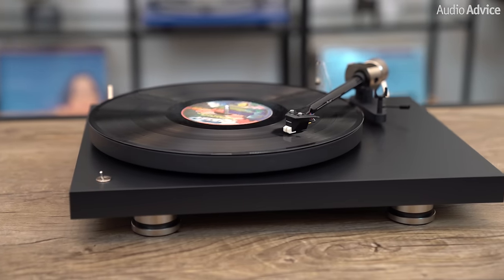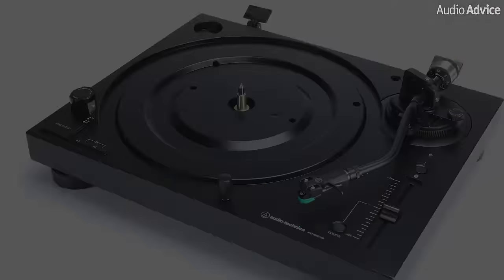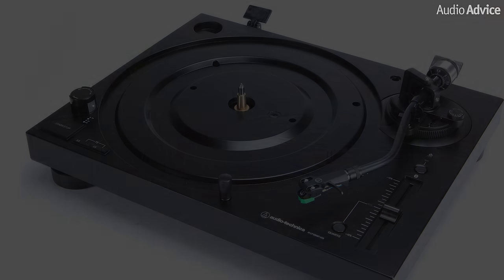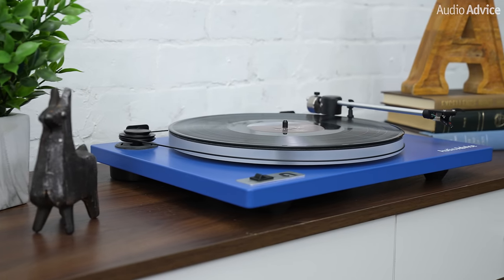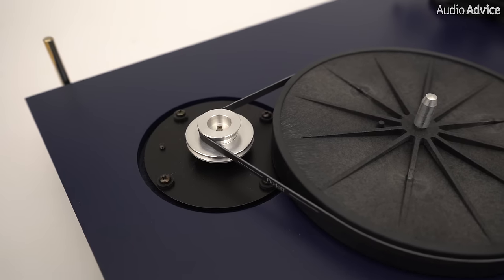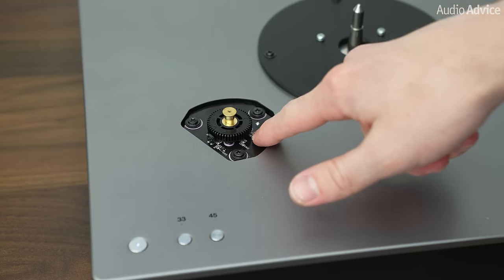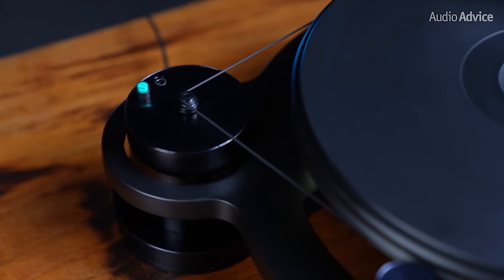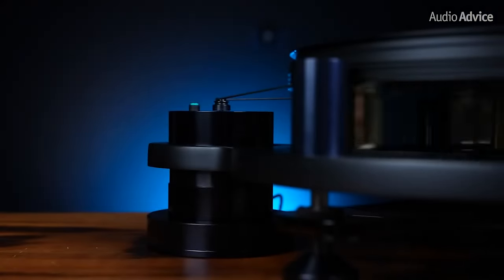There are several factors that can adversely affect the sound of your turntable. As your stylus is tracking through the grooves, you want it to pick up what is only in those grooves and nothing else. What if you have a large high-torque motor sitting right under the platter? That's what you have with direct drive, and thus you run the risk of the noise from the motor getting into your platter and being picked up as background rumble by your stylus. Belt drive inherently helps isolate the platter from the motor because the only connection is a rubber belt. Almost all belt drive turntables worth any salt also suspend the motor so it is not fully connected to your turntable — some even have it totally separate from the turntable. The odds are this method is going to give you less chance of motor noise getting into your sound.